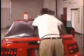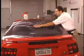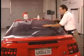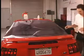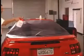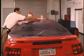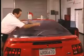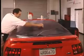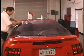Lay a piece of film over the outside of the window with the factory edges at the top and the bottom. Move it around so it evenly covers the glass, stretching the film out with your hand and using the H pattern area to hold it down. Now mist the center with mounting solution. Squeegee out over the H pattern you made to anchor the film and spread it out evenly. This will give you a starting point for working on both pockets.